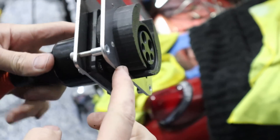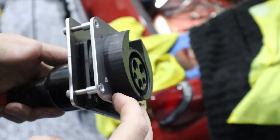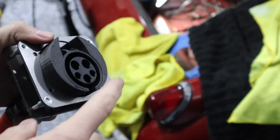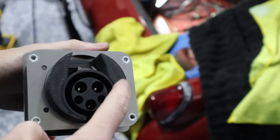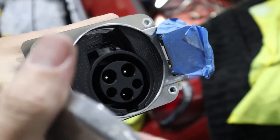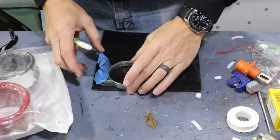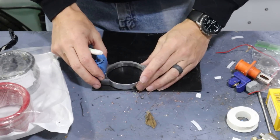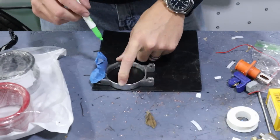This plate attaches to the plug, this one fastens to the car, and then they fasten to each other — that's what keeps the plug in place. There's also a 3D-printed part that will allow the vintage gas cap to fit on there. I'm going to make a custom gasket from some rubber, trace this out, and cut it out.